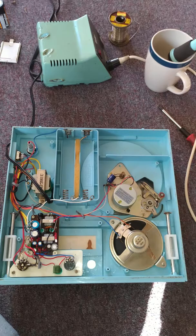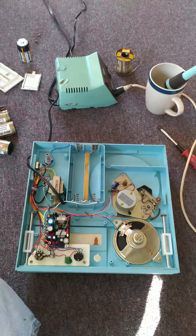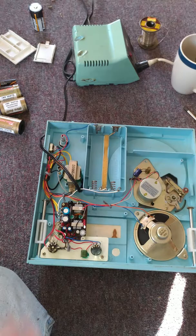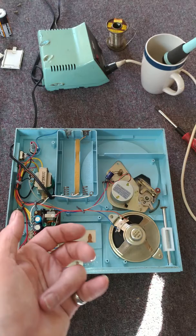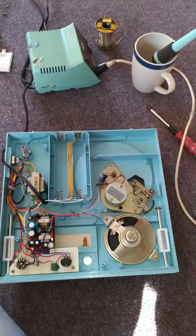So this is my little trick, my little challenge. When I put the batteries in and put the record on and put the needle on, the motor started slowing down — rolling flutter. I'm thinking, what's going on here? I replaced all the caps in the amp. I went ahead and lubricated the platter, the shaft, and also the idler wheel shaft. I cleaned the idler wheel and put a little WD-40 in the motor.